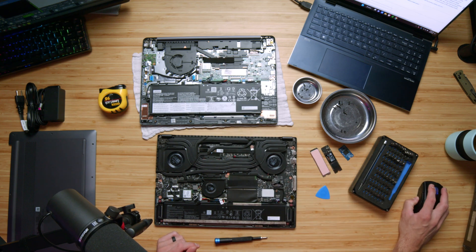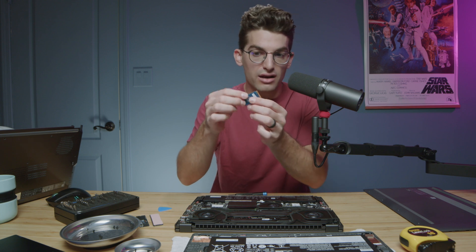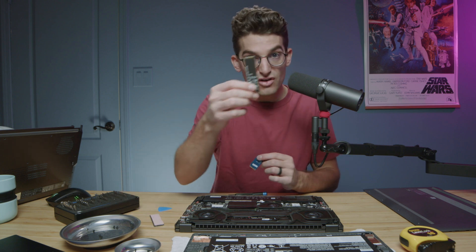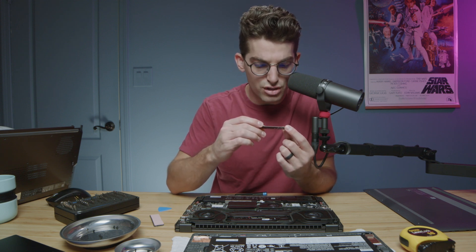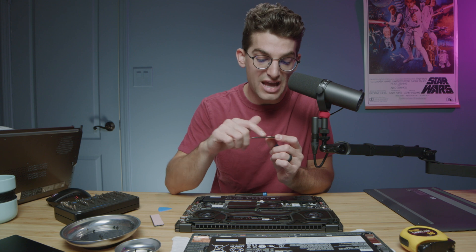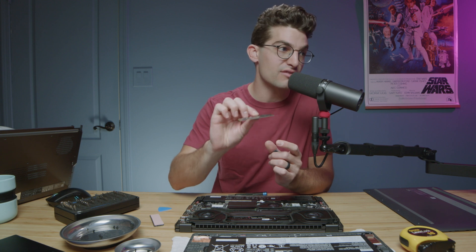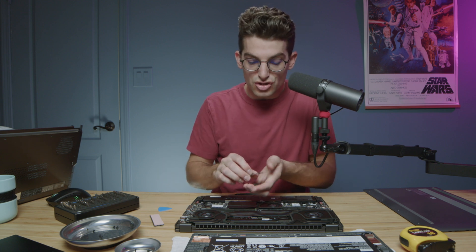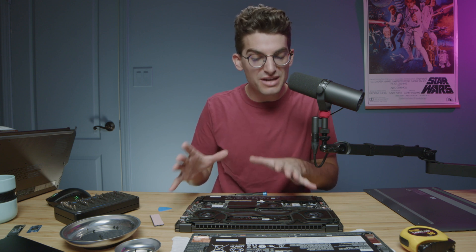It's really important when you're going to upgrade your drive that you measure it if it is an oddly shaped or odd-length drive. The 2280 is a very common drive and you might be able to find the numbering on the drive when you pull it out, but it won't be obvious - you'll have to look very faintly at the numbering etched on the actual module. If you have any questions on how to find the right drive or the right RAM sticks, I'd love to make some videos. I hope this helps you pick the right drive when upgrading your laptop.